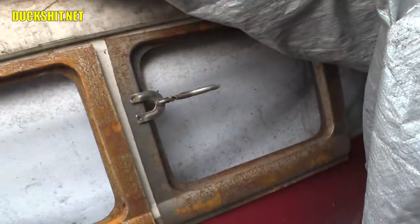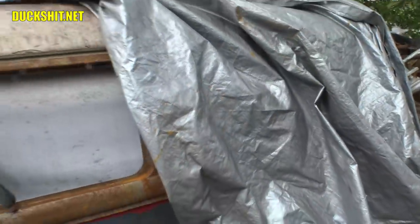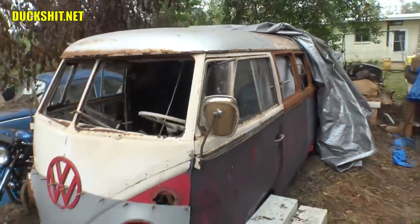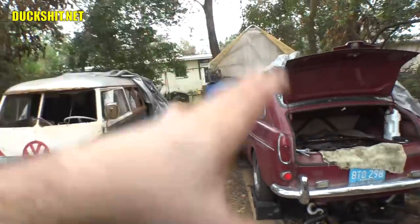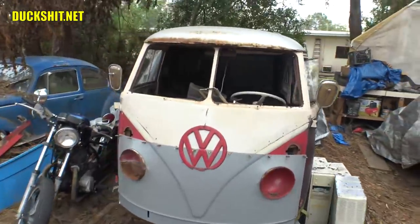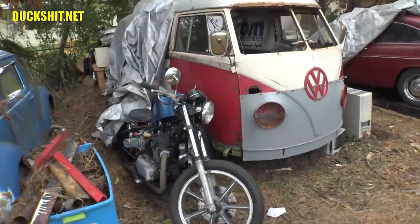All these window pieces — these got it the worst. They had almost no rust on them at all, maybe just a dot here and there, and they flash rusted up pretty bad. I need to soak those in some phosphoric acid, and after that, once they're clean, get them back in the house. I think I need to store them inside from here forward until I get them attached to the bus permanently. I'm not ready to attach them yet because I don't know what the spacing is going to be. When I figure out what I'm doing with the roof, I'll figure out where the window spacing is going to be. Some of the pieces back here didn't see as much rain and didn't get quite as much rust. If I had known the storm was coming, I probably would have pulled tarps over both the bus and Ruby — but I wasn't here for it, I was out of town.